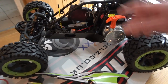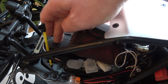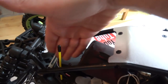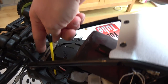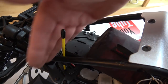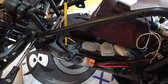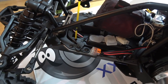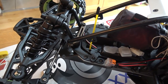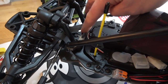The steering setup is also different - you have a centre servo with what I believe is called sim steer, so the servo is on the centreline and the steering connection goes down underneath. On a normal Baja the servo points sideways, which means it turns one way better than the other. This setup is better, and a lot of people put this on their Bajas as an upgrade. There's also a nice alloy brace here.